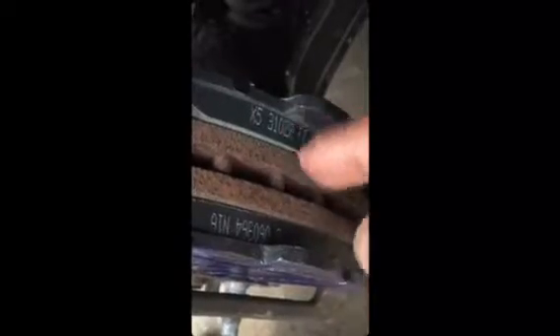Trying not to touch it — wear gloves, ladies and gentlemen. See those little grooved slots? They just slip right in there. Take the other one — wear gloves because this stuff goes through your skin; skin absorbs everything. The pad should touch the rotor, just like that. Now the problem is, as the caliper squeezes and squeezes as the pads get smaller, the piston comes out more to help you stop. So this is not going to fit over that — we got to press that in.